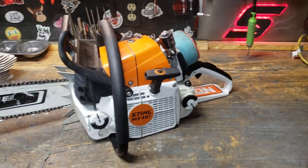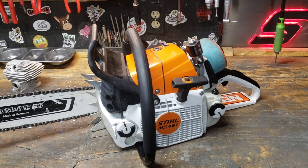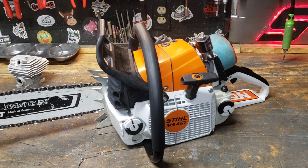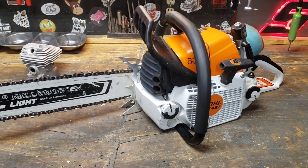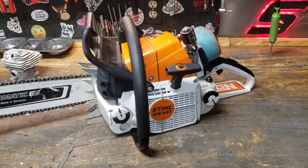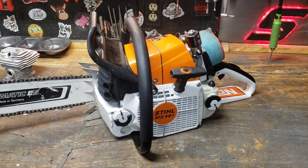Well guys, I accidentally built the best running 461 I've ever got my hands on — no joke. Now once I lower that compression it's probably not going to run as good, but the nitrous is going to make up for that. I don't know how reliable it would be — it's going to have premature ring wear from all that finger porting. It might only run for 20 hours and catch a ring, or start to eat the cylinder away.